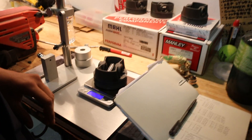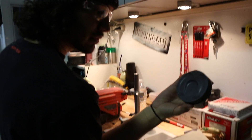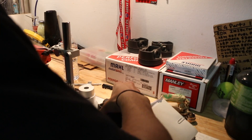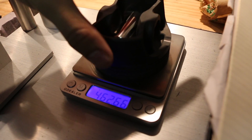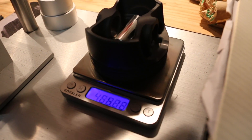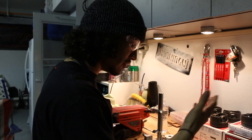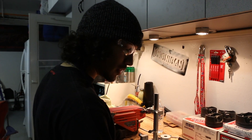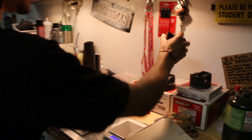We are at 462.65 — that was our baseline for piston one. Here's piston one with the wrist pin in it. These are all measurements with the wrist pins inside. Sometimes it takes a couple of tries to get the exact measurement. I got a repeatable reading of 462.65, and that's what I'm going off of as the baseline.